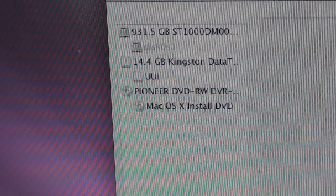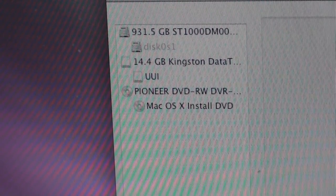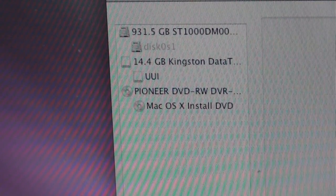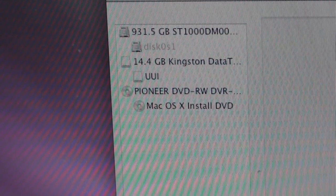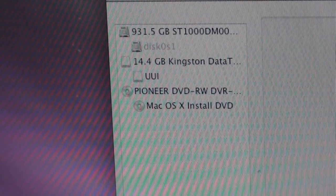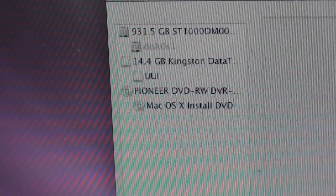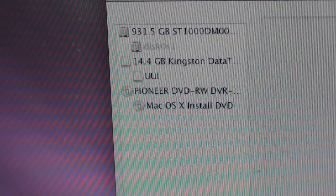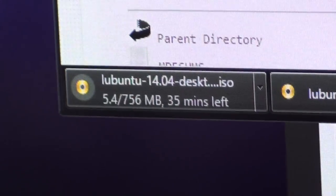It was kind of a long shot for this to work anyway. But if we are going to use a CD or DVD to install off of, I think instead I'm going to switch down the version, go down to version 14 of Linux, just because the PowerPC image is small enough to fit on a CD. Because something tells me that if I start throwing dual-layer DVDs at this thing, it's gonna croak. So let's download that instead.